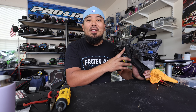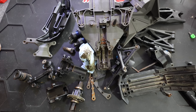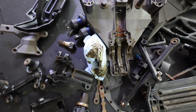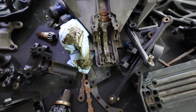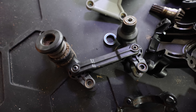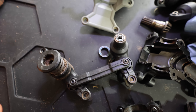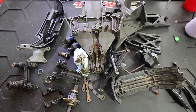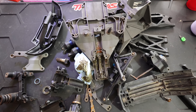The goal is for it to function like a perfectly new X-Max. Oh my goodness — this is what RC nightmares are made of. I took everything apart and look at this: this wipe is just from the diff case — there was grease all inside. The front diff is definitely leaking. There's also very fine dirt, almost like sand. I'm convinced they either ran this on very fine dirt or on the beach, which is probably why everything is so rusted. Some bearings down here are completely seized.